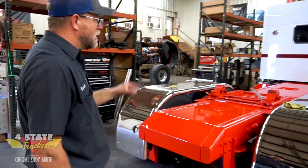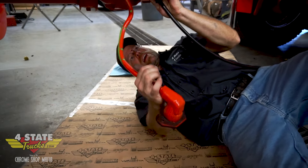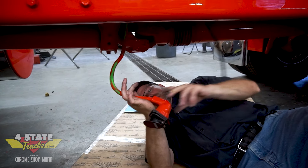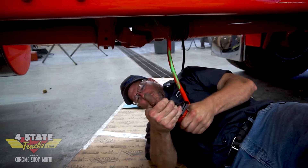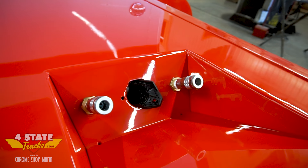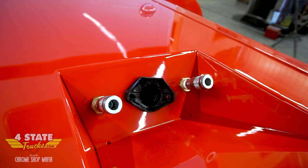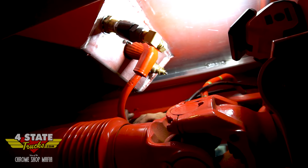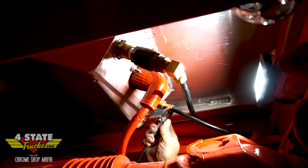Now it's got to get our seven-wire hooked up and run the airlines to the couplers up front. Here's my seven-wire plug and my service and emergency brake lines hooked to the fittings down below. First thing I want to do is get this fed through — I didn't want to cut this end off, so I made a special size hole. This socket just plugs into the harness here. I'm going to squeeze this down and force it through the hole — that's essentially how it's mounted from the factory. Put the socket back on over it, make sure it's attached good. I need to make sure I can keep this electric line out of the driveline, so I'll hook up that line tight. Check valve's tight, compression fitting's tight — all solid.